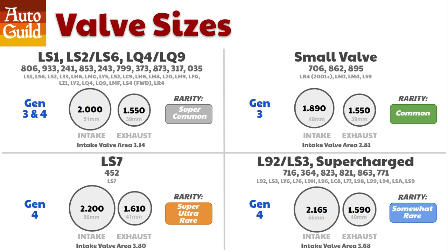All LS heads have only four different valve size combinations. I've made the valve sizes to scale so you can see the differences in size are pretty minimal. Some valve sizes cannot even be used on some engines because the bore size is too small and the valves will actually hit the block. I'm currently working on a cylinder head compatibility video, so please subscribe if you are interested in that. If this is getting too confusing, I have the rankings and summary at the end of the video.